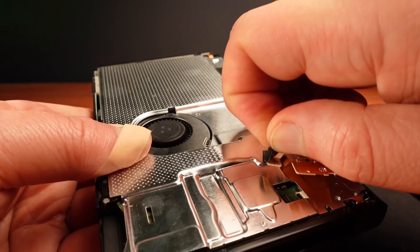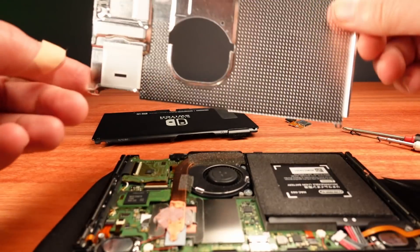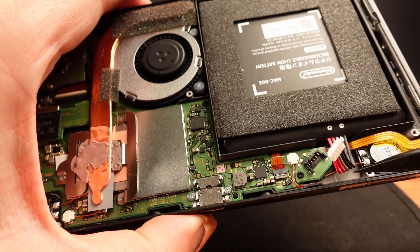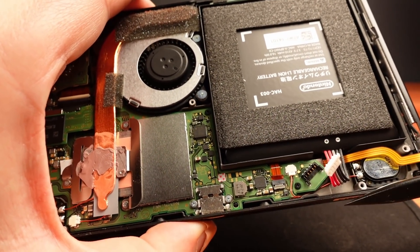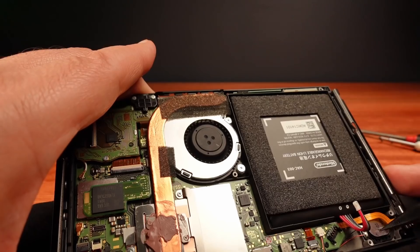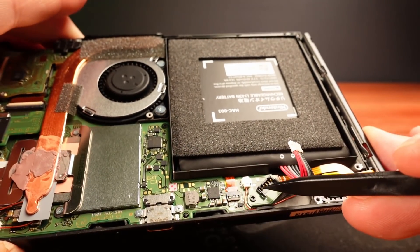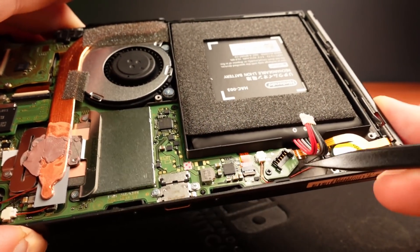Just take that rubber bit out. There is a nice gap inside near the battery connector that looks ideal, and then maybe cut a section out of the casing so I can flip it on and off from outside and control the battery connection. I've checked continuity on these wires and the two positives are joined together at the battery end and at the switch end, so I'm just going to cut these and join them together through the switch and out again.